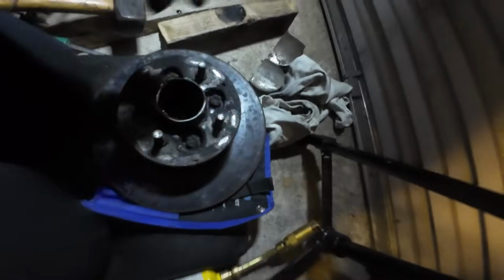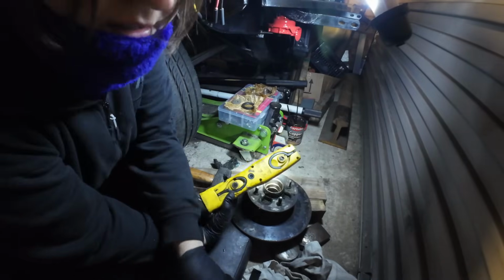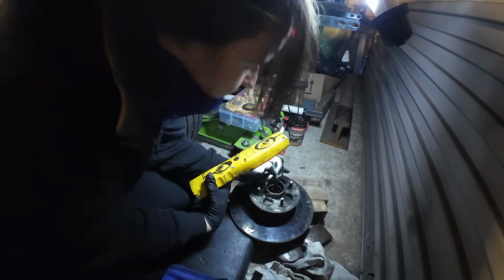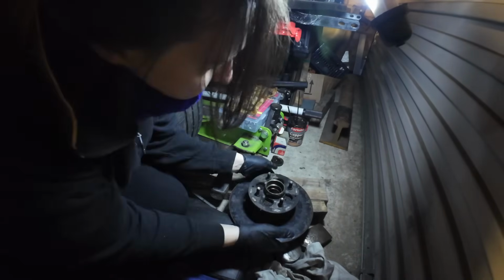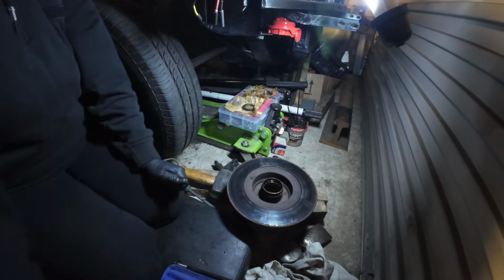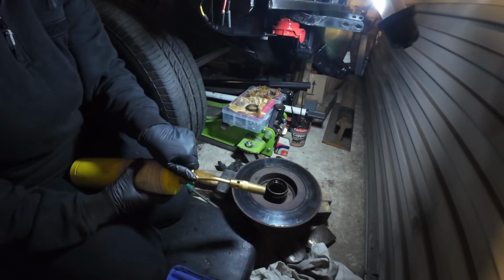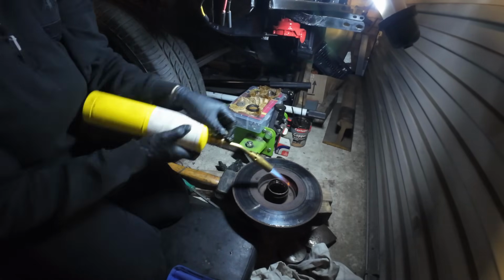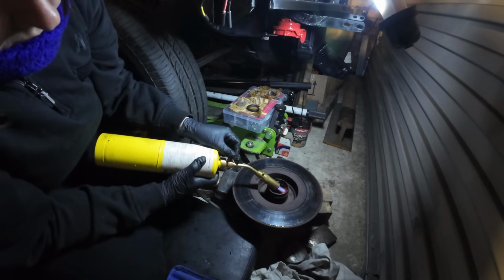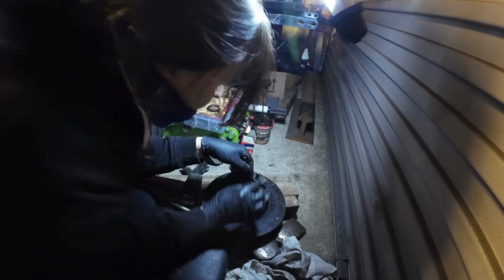So we'll heat up the other side as well, and we'll get that one out. Again, looking inside this, there's 2 little notches where you can just get the punch on there nicely. So I'll spin it round, heat it up like we did the other one, and I reckon we'll be able to knock that out in a couple of punches. Let's get this punch on the road.